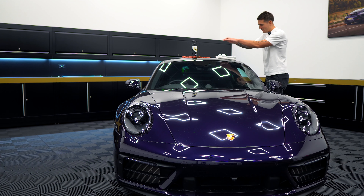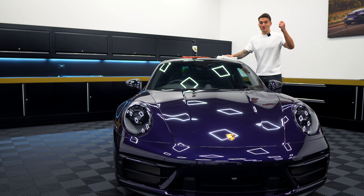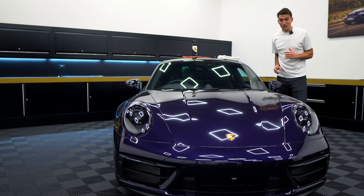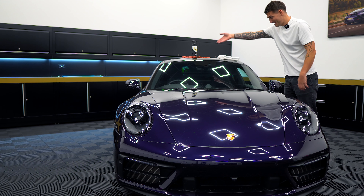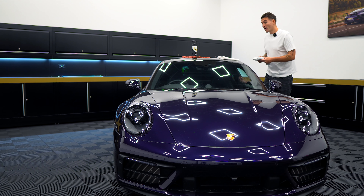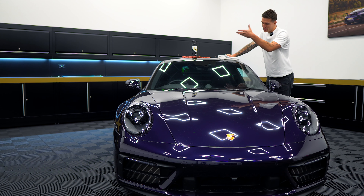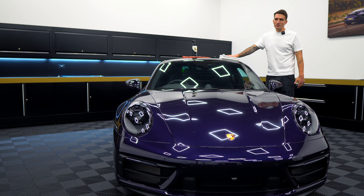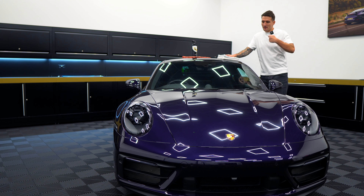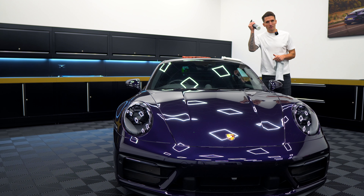As you've seen, when you have the best paint protection on the car and the best blower — with the stubby nozzle and rubberized band — it's a fantastic thing, and these will outlive you if you look after them. During the blow-off stage, I've got maybe seven beads here, three beads there. You want to be almost drying a dry car, just as you want to be almost washing a clean car. If I were drying an unprotected piece of glass right now, it would carry a lot more water and it'd just snowball from there. The drying aid does work on unprotected paint, but protected paint is where this really shines.